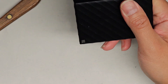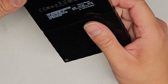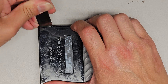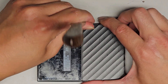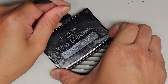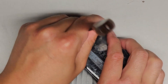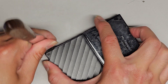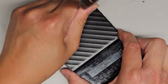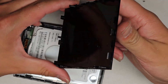There's something rolling around in that one, and this one doesn't have that issue, so I'm pretty sure this one's completely dead. Another My Passport — let's go ahead and open this up. Same thing, we'll go to the corner. You can see it's lifting. Go to the middle, lift that, go to the other corner, lift that. Corner, middle, corner — we had to go slightly away from the corner on one spot. Again, we got that out, no clips broken.